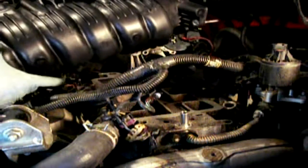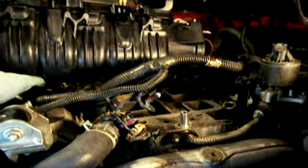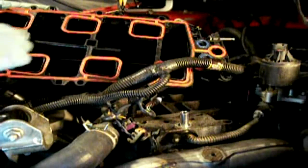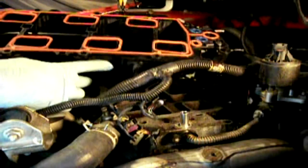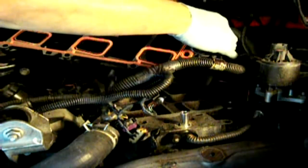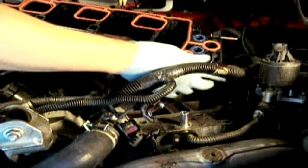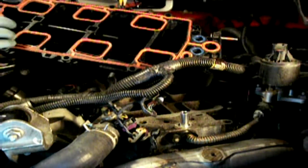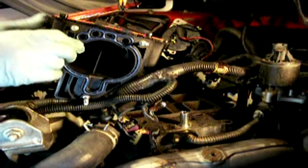You'll have nice instructions on all this. You'll have to snap some of these components in place, set the gasket in place, and set your EGR tube inside the plenum as well. Once you set that up and set your gasket in place correctly — it has some double pins that go into the guide holes — and once you snap that in place and press it in its correct spot, then you're ready to install your manifold.